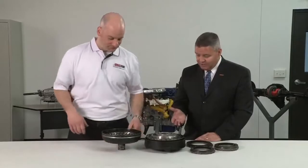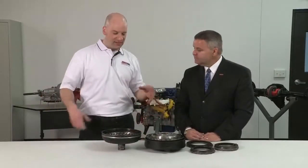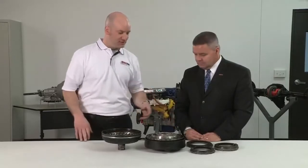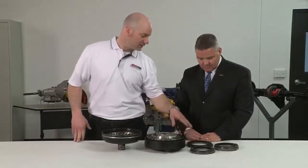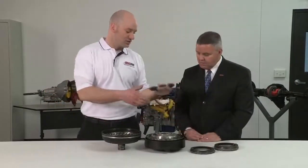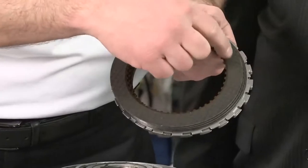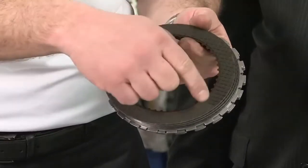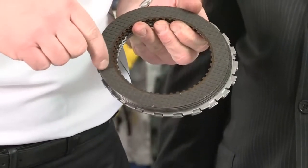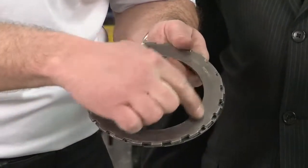And I'm not a transmission expert, but this equipment looks pretty clean to me. Scott actually had this stuff all analyzed. He had the converter opened up, as you can see here. He had the transmission builder open up the transmission internals. And what they found was that these clutches looked so good. Now normally if the fluid would have failed, you would see black buildup, you would see all kinds of charred remains of clutches, and this clutch would have failed. You would see bluing on these discs. None, there's none to see there.